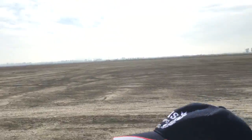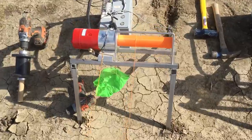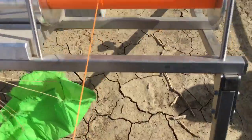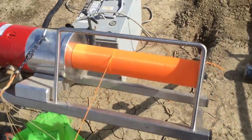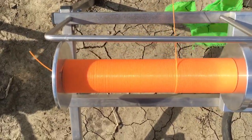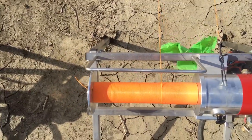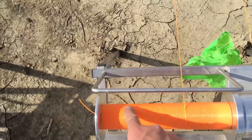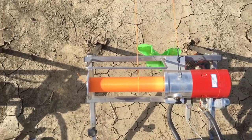Everything about snapping those lines — very important, please don't neglect that. The next step: we're going to lift the winch. It's under tension right now. We're going to lift it and let the front legs settle into the ground properly to where they'll stay all day. If we don't do that, they could shift later under big tension. Pick up both legs at once, lift the winch, and let it shift and settle. Now come back and check if your winch is aligned. If you did it right with the nail, when you look at the line, it should be exactly at 90 degrees to the drum, with the line going straight back to the turnaround. If you've done that, your winch is aligned properly.